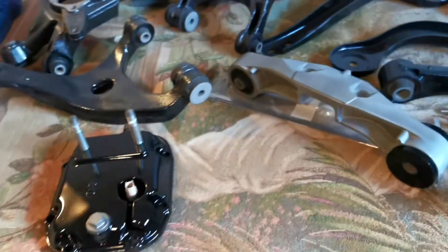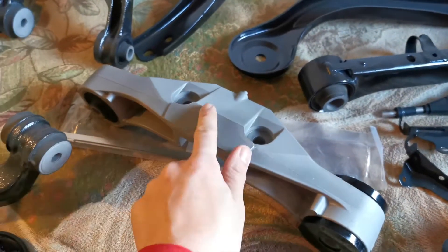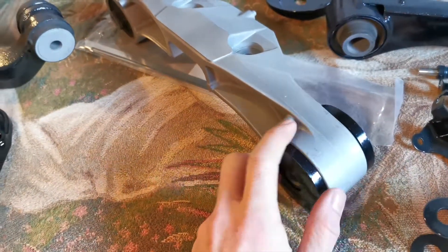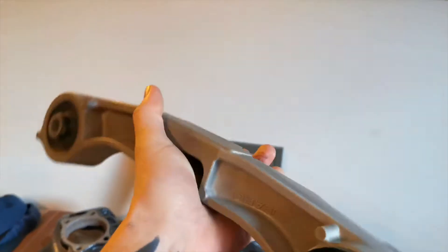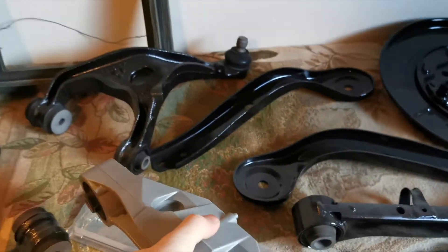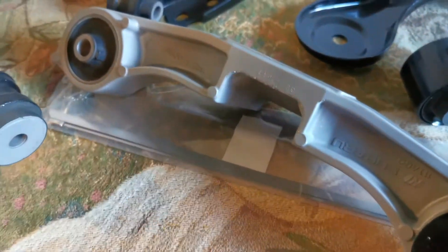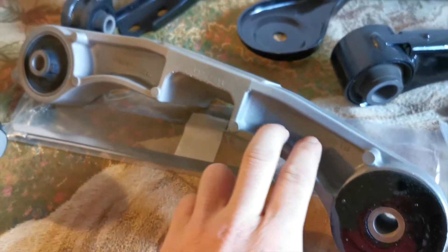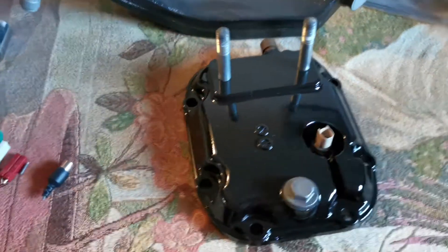This cradle here got blasted and cleaned up as well. It's coated in a few coats of diamond clear coat - it's pretty subtle, but compared to what it used to look like it's a little more shiny and cleaner looking. I really like how this turned out - there's about five coats of clear coat on this. It's a KBS coating direct to metal so I didn't have to prime it.